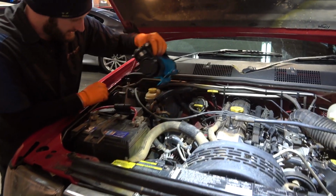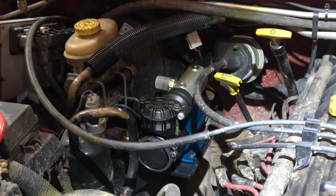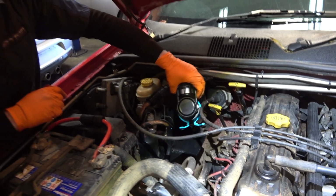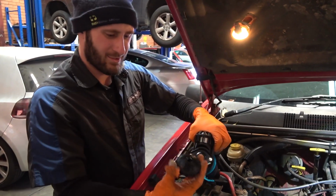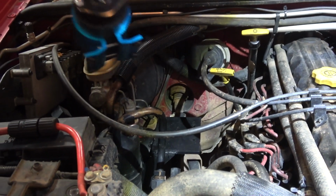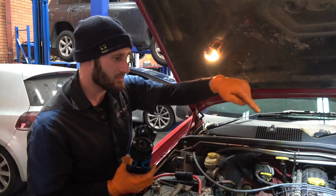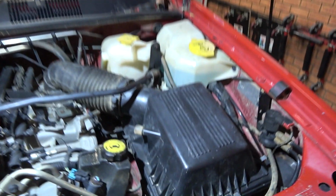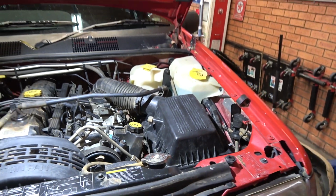So the compressor is going to go here. What's this for, a locker, eh? This is for the locker, but I don't want to have this stupid air filter here, because how's that going to work? Yeah, as soon as you go in mud, as soon as you go in the water, she's done. So run a fitting off there, MPT fitting, put a hose straight onto that. Mate, comes ready for this from factory, eh? Hose goes straight across, you wouldn't even know.